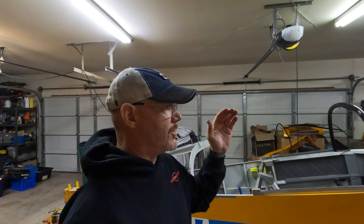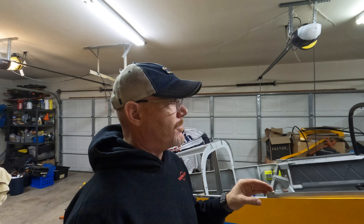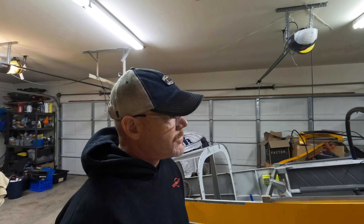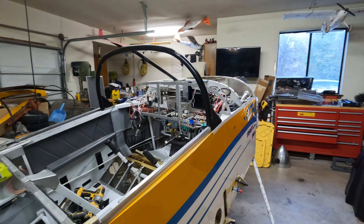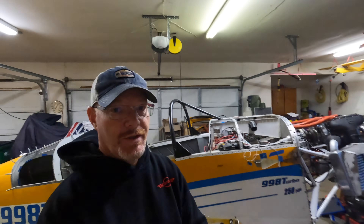It's also whether or not you'd be interested in the Yamaha firewall forward. I've gone back and forth on it myself. The performance of it is outstanding, but the fact that it's the only one of its kind does come with some issues. It definitely could be modified back to a Lycoming — it would require a new engine mount, new cowling, and obviously an engine. There's not a ton that needs to be done from the firewall back to accommodate that, so you can really go either way on it.